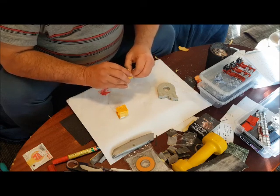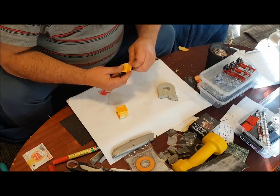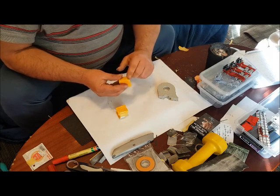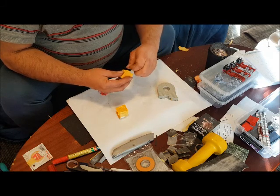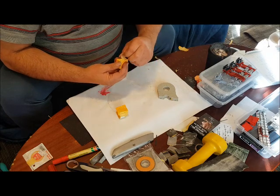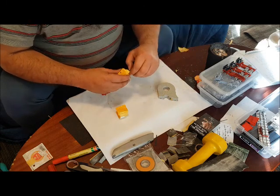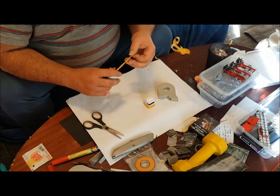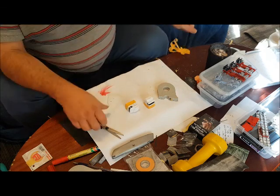Pull one of these apart so you can see the effect that you get. Take that down. Now what I've done is I've actually taped the top part that's going to be blue, so there's no overspray, so you don't get that lemony look, or that orange peel look, or reduce the chance of an orange peel look. And the colour's going to be more even. There you go, that's two cabs.